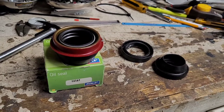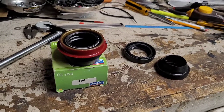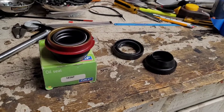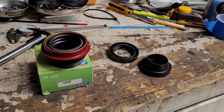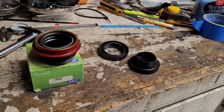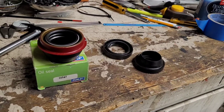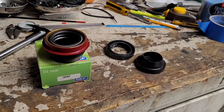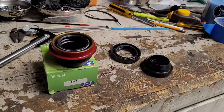The reason why these seals are hard to find is that the Tremec T56 Magnum was an aftermarket transmission. The T56 was designed and built by BorgWarner starting in 1992 — they put it in the Viper, the Camaro, and the Mustang, and quite a few Aston Martin high-end cars had it too. But the standard T56 only had a maximum torque rating of around 550 foot-pounds.